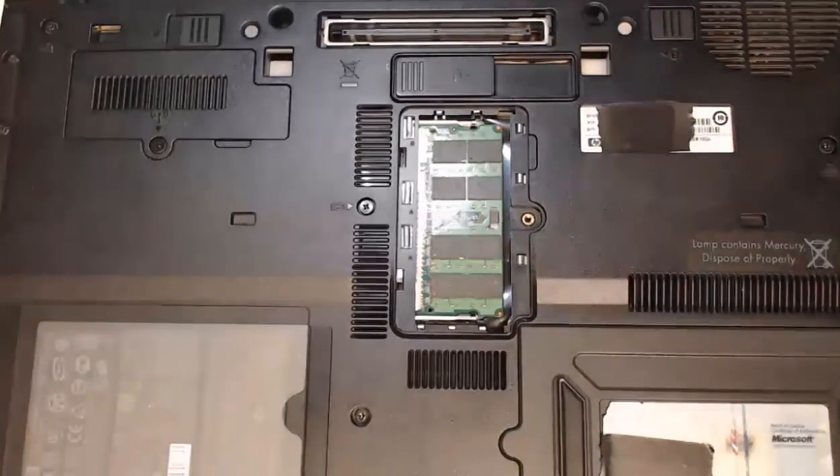What you saw was only one RAM chip. Commonly laptops have two, so where's the second one? Depending on the laptop and manufacturer, that second RAM slot is probably under the keyboard, which means we would have to remove the corresponding screws to gain access under the keyboard and touchpad, where we would find the second RAM slot. We can go about doing that in another video.